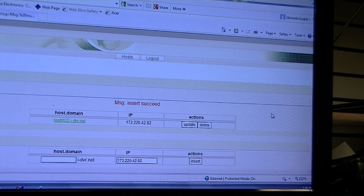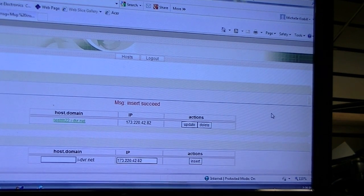It's best to do this from the computer on the same network that the DVR is being installed on — that way you get the WAN IP from that network. When the domain name DDNS name pulls up under Host Manager, you have successfully created the DDNS name.